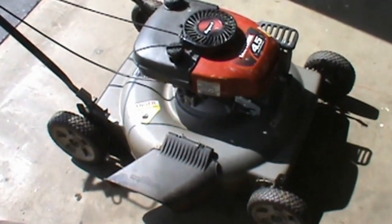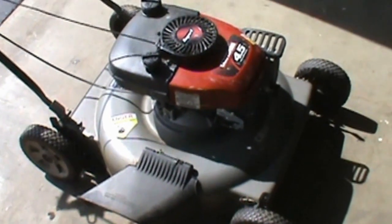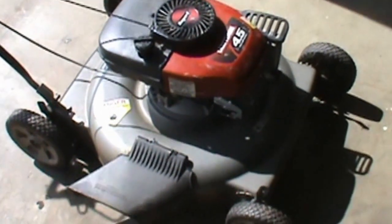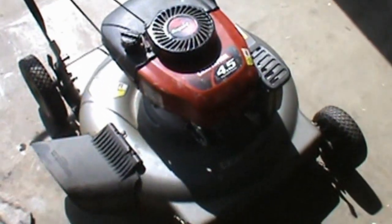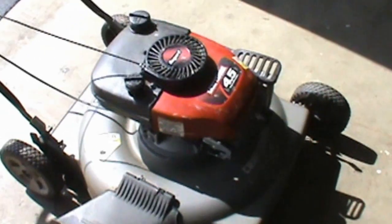How's it going guys, this is Double Wide Six. Today I have a little video for you — we're going to diagnose whether or not a coil is working in a lawn mower. This lawn mower doesn't have spark. Sometimes if your coil's going bad, you'll notice when the mower gets hot it'll stall and won't restart when hot, but when it's cold it will restart. This particular mower has no spark whatsoever.